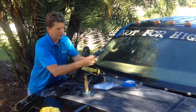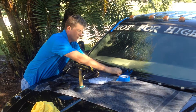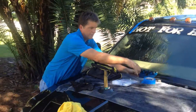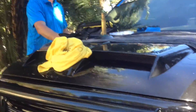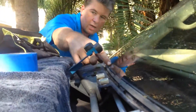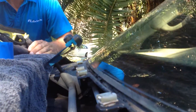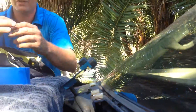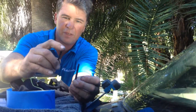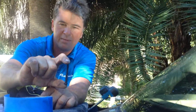With a standard configuration, you're way too high off the windshield to get the proper angle for a set. That's why your hardware kit comes with two sets of longer screws. You have a medium-sized screw, which is for what we call a single drop, and you have an over two-inch screw for a double drop.